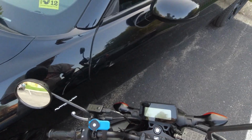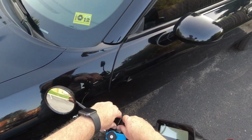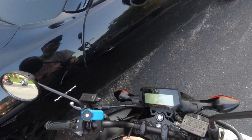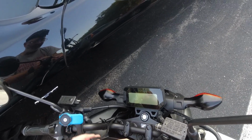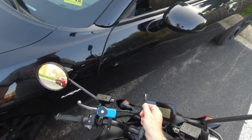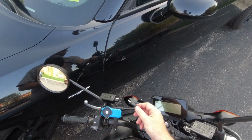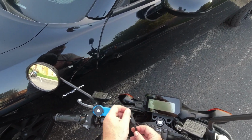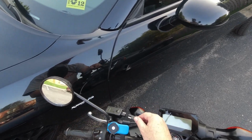I mean, unless, anyways. So one thing that I did is I did hook up a spot for a battery tender. The cool thing is that you can see I wrapped the cable in some really nice 3M Super 33 electrical tape, and brought it up here. Now this is connected directly to my battery, so if I needed to use a jump box or a trickle charger, right, it's right here. The other end had a nice finished cable plug end thing, but this one doesn't. But it doesn't really matter, because it's gonna live up here with this thing.